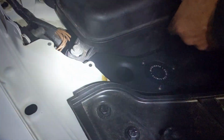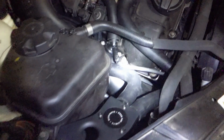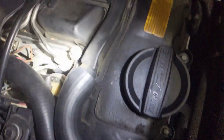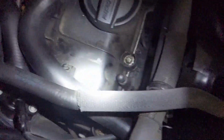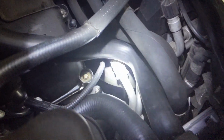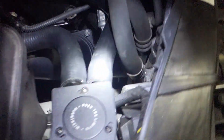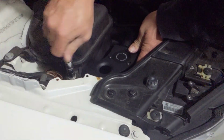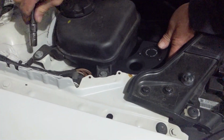Putting the 10mm bolt back in. So you can kind of see, there's the outlet hose going down, wrapping around the intake underneath that little shroud, coming down and hooking up to the heater. And the inlet hose, there's the port for the inlet, going down, getting tucked down there so it will protrude, I guess, for the plastic cover, and then hooking up to the intake port on the catch can. Look at that. Tightening up the bolts. Righty tighty, lefty loosey.